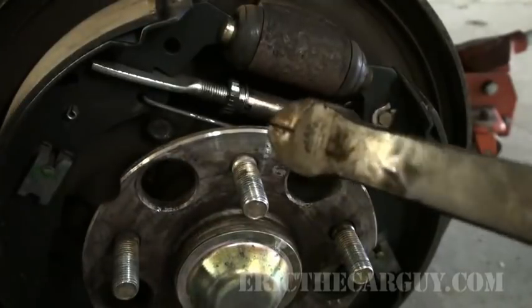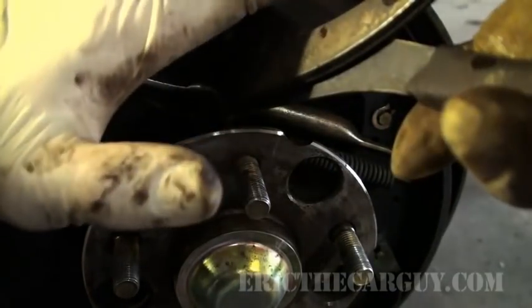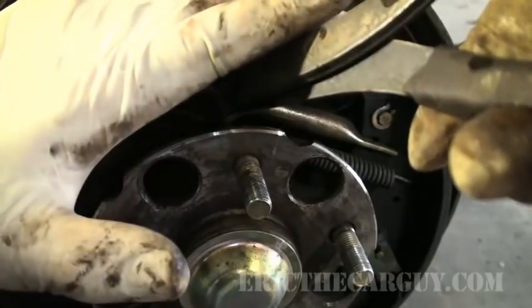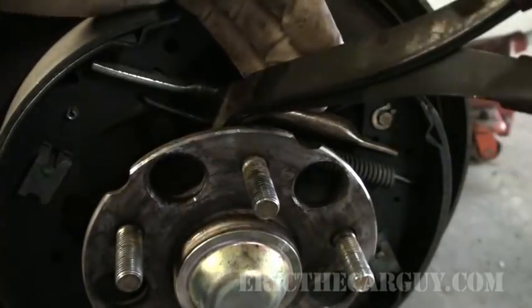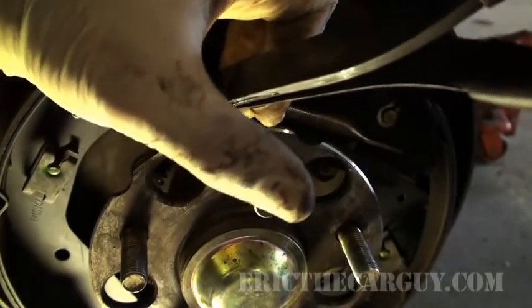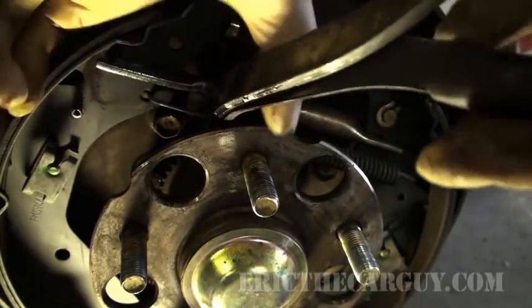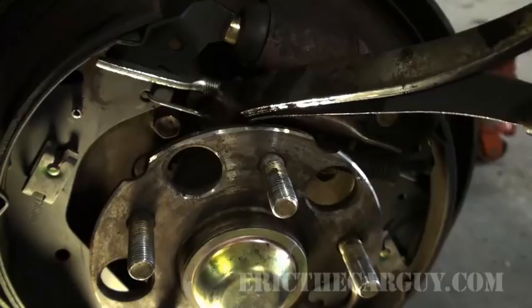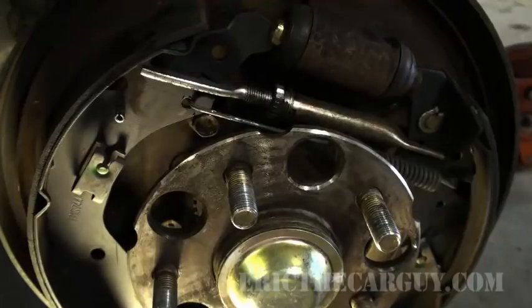These are made by Mac. The idea is I'm going to grab the spring and put the palm of my hand on the brake shoe, then pull with my fingers to get the leverage — squeezing with the pliers, pushing with the palm of my hand on the shoes — and unhook it. Be careful because you don't want to compromise your wheel cylinder; if you do that you'll have to do some brake bleeding.